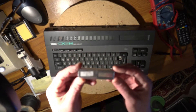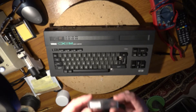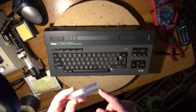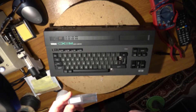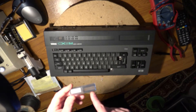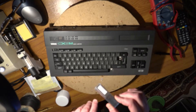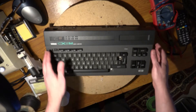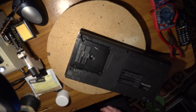Now the actual ROM chip itself is soldered into the board. The person I bought this from on eBay, it came with a DIP socket as well, so the first thing I will do is remove the old chip, put the DIP socket in, I will then put the old chip back into the computer to make sure it still works, and I will then install the new chip because the new chip needs a slight bit of modification. So the first thing I'm going to do is remove the interface from the back of the computer.